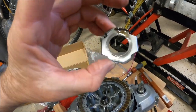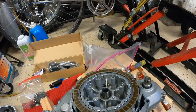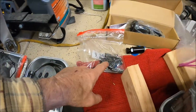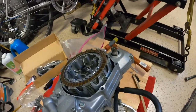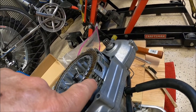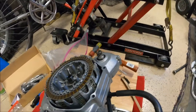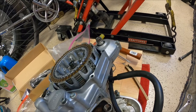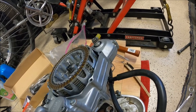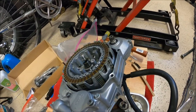This is a mangled-up washer so I'll have to get a new one, but once you get everything put together you just bend the tabs over and that keeps your clutch from coming undone. I'm going to pull this whole pack out in one unit and then put the pressure plate back on with a couple of springs just to hold it together. Looking at the clutch plates, they're stacked with notch, no notch, notch, no notch — it just keeps going like that down to the judder springs. The outer and very first inner clutch plate and steels are different, but otherwise it's all the same.